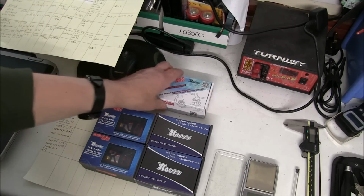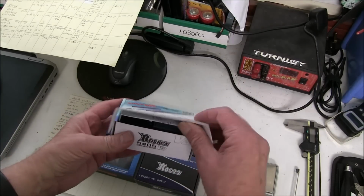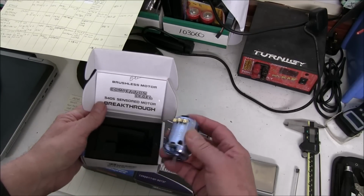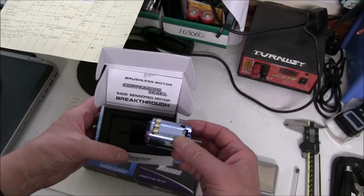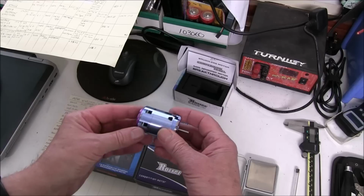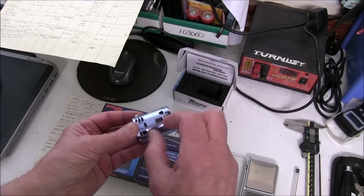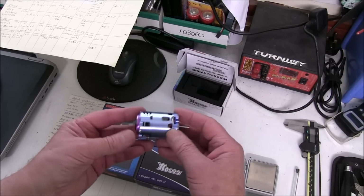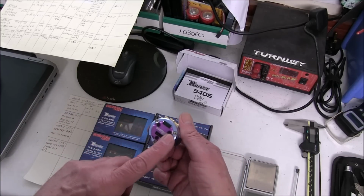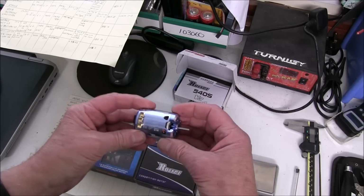Now briefly, the Surpass version 3 was a very good motor, and another thing about it is that they're cheaper than most other motors because they don't go through a lot of middle companies. They come direct from the factory, so they're pretty cheap. Now this was the version 3. A bit old-fashioned in some ways, not many cooling holes, but it had a very good, state-of-the-art stator, and nice tight winding with no plastic or anything making the wires longer than they need to be. And it was a good motor, with a nice strong rotor. So that was the version 3.